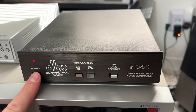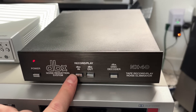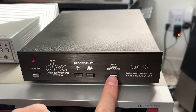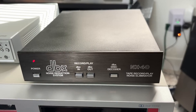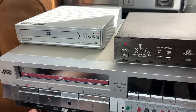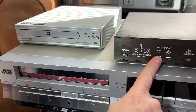Make sure your DBX decoder is powered on and set to DBX in. These little switches over time have a tendency to get dirty, so you might have to clean them with some contact cleaner. This setting is for disc decoding only — there were pre-recorded DBX discs at 33 and a third RPM, and if you have one properly connected to your receiver, you can decode a record encoded with DBX. Don't do what I did the first time: make sure you have Dolby noise reduction turned off on your VCR. You don't want to encode with DBX and Dolby at the same time. NR is off, DBX is in.